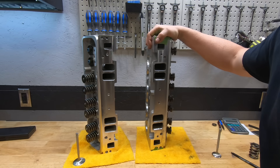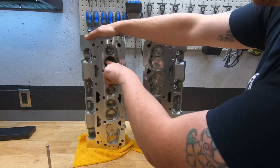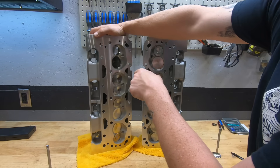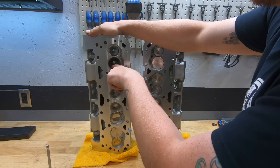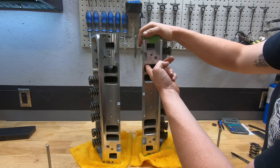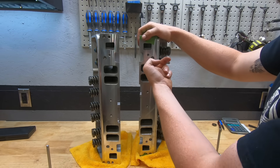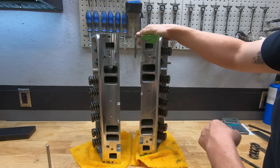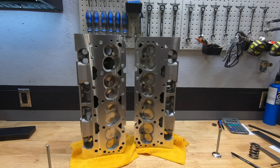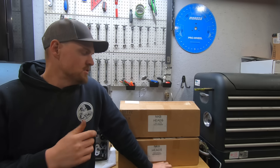If that isn't enough and you want to do a little port cleanup — clean up the port especially where the seat blends into the runner, take that edge off, blend the seat back — you don't want to take too much material because the throats are already pretty big for the valve size. Clean up any slag, polish the chamber, clean up the runner. I opened up the runner slightly at the pushrod pinch point — about 70-thou versus stock — and I'll show you the flow numbers for all that combined with the back-cut valve.